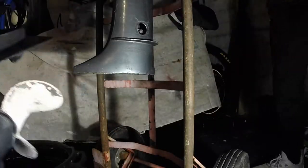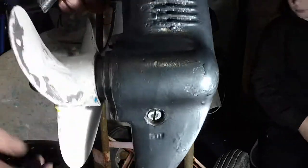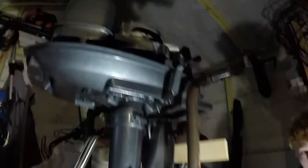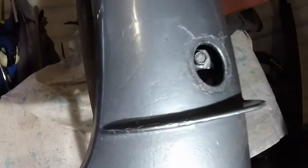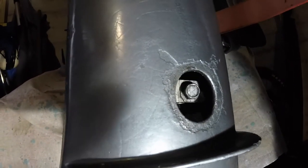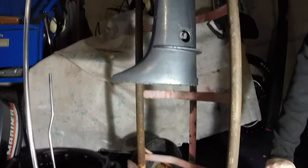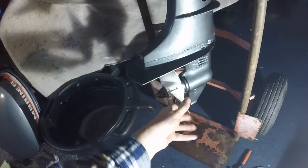So here's the gear and drive shaft - we've currently got it in neutral. We'll put the lever on the outboard in the upright position, which is neutral. This bolt in here connects on to this, more like a clamp. Do you want to move that handle Harrison, back and forth? You see how it moves? That's it - in neutral, top dead centre. And then we'll just connect her on. Spinning in neutral, in reverse, and then in forward. Seems good.